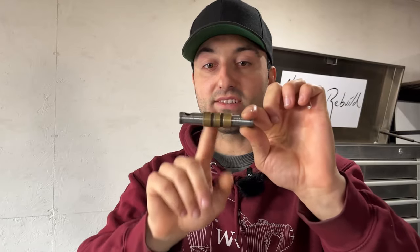Usually between two mechanical components you have one clearance — one part is stationary and the other rotates. In this case the rocker arm shaft bolts to the cylinder head and the rocker arm itself pivots on the shaft. There's one clearance between these two parts, filled with oil so they don't actually touch. BMW took a different approach: with the original used rocker arm shaft and bushing, there's a clearance between the shaft and bushing, but also a second clearance between the bushing outside diameter and the rocker arm inside diameter. So between three parts you have two clearances. As the parts from Germany showed, it's much harder to machine three parts accurately than two. I'm not sure why BMW chose this route — if you know, please let me know in the comments.